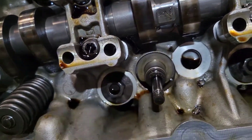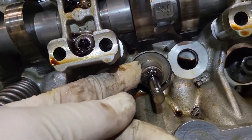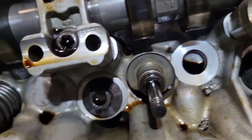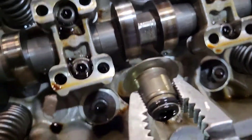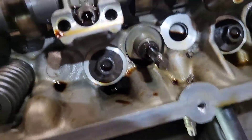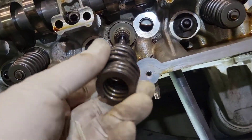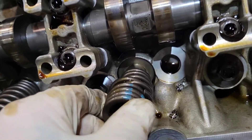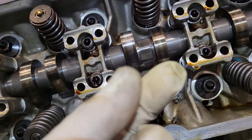This valve is up, and when I release the air pressure from this the valve is going to drop, so you want to make sure you keep the air on there. Now is a good time to go ahead and replace your valve stem seal as well — there are updated stem seals. It comes off that easy. Then you're just going to get your new one, lubricate it, slide it on, set your spring up the same way, put it on, depress it until you can get your keepers back in, set your keepers in there, and then release the tension.